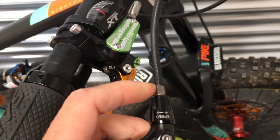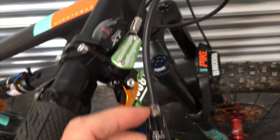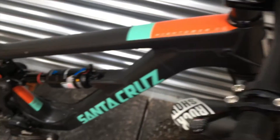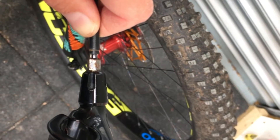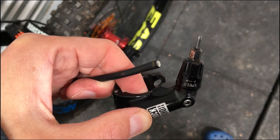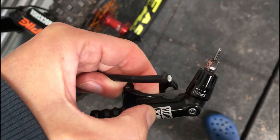What I need to do now is unscrew the hose from this adjuster, because the hose needs to be pulled back through the frame and then out through the top of the seat tube. The hose is just screwed on here, so it's just a case of undoing this. Keep winding it and it'll wind right off, and you'll be left with the hose and the lever part.